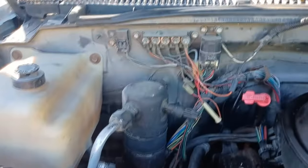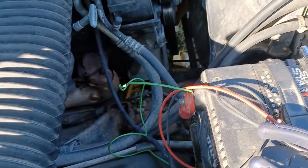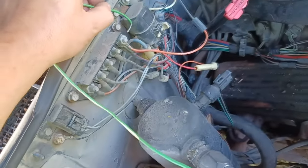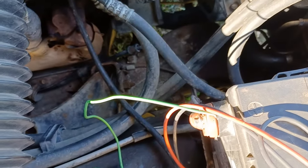So that tells me I've burned out a fusible link. Looks like the other ones are up near the junction block. This one's down here. So I hooked up this secondary wire — don't try this at home, it's the wrong gauge. Hooked up the battery, touched this wire to that post, and there's light. So that tells me that cable is bad.